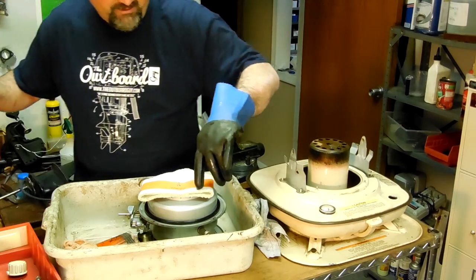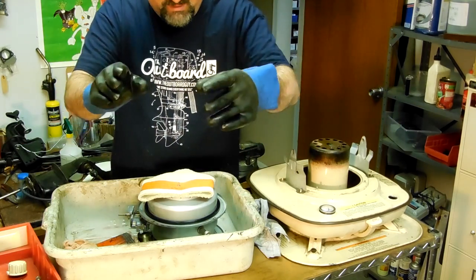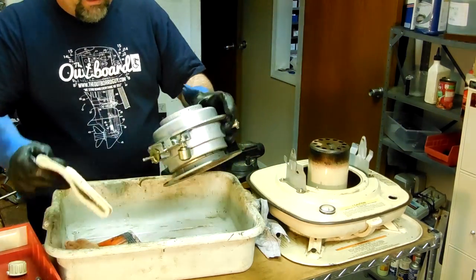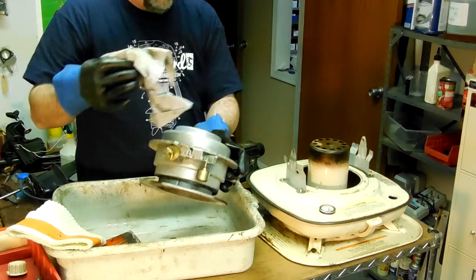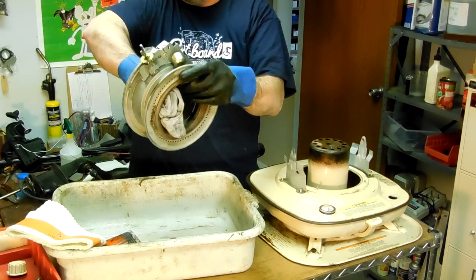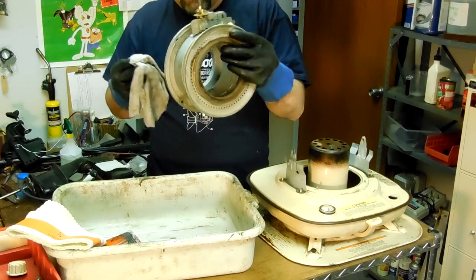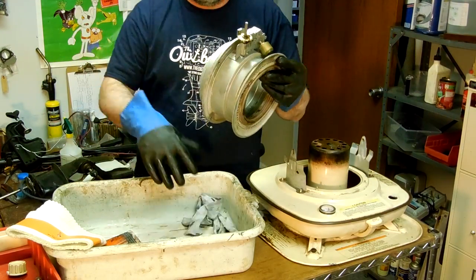This part is made of fiberglass, and this part down here is made of cotton. The cotton pulls the oil up and wicks it into the fiberglass, and the fiberglass doesn't burn — so when you dry burn, that's why it doesn't ruin your wick. I used to think you should never let it dry out, but it's actually the opposite: let the tank burn until it's empty and go out on its own. Every three or four tanks — or more often if you've got bad kerosene — it burns off the carbon that stops the flow.